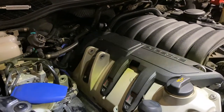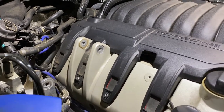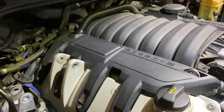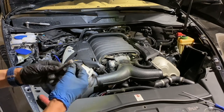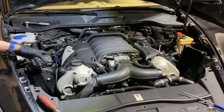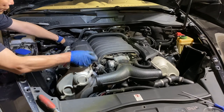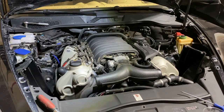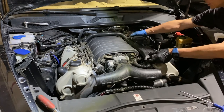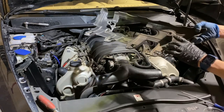So with the arm now out of the way, it gives more clearance to remove those two extra bolts in order to remove the plastic cover. I removed the screw, and just for reference, this was T30. Once I remove this, there are two plastic or rubber grommets underneath. Just wiggle them and pop them out. Another plastic piece out. Similarly, doing the same thing, pull this out. There are two little metal stubs here that go into the two rubber grommets.